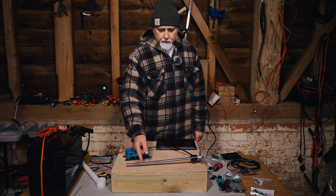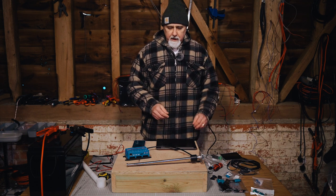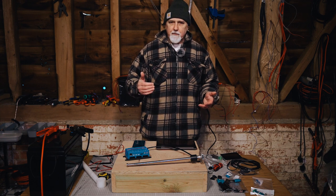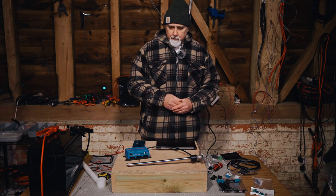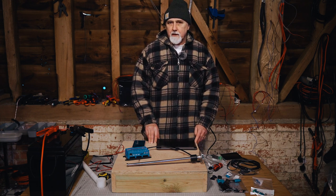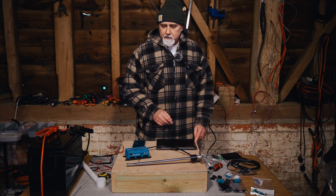A lot of different makes of these sensor units are fairly inexpensive but they just do quarters — only showing 25, 50, 75, and full. I already get that from the existing dial on the camper, and it's frustrating because you never know if 75% full means nearly 100% or just 76%. There's quite a big variation in a quarter of a tank. So I wanted something that would tell me precisely exactly how much I have. This particular unit does increments of 1%, so there will be a hundred increments — giving me a very accurate idea of the tank level.